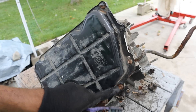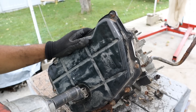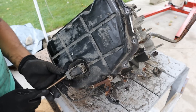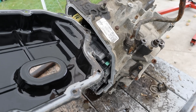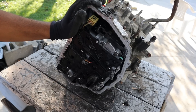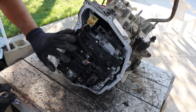This here is the trigger wheel for the output shaft speed sensor. Next I'm going to try to remove this transmission pan. Now some of these fasteners are so crusty — normally I'd use my wife's toothbrush but these are so crusty I might have to use my grandfather's toothbrush. And with a lot of prayers, we're going to try to get these bolts out. Well normally there'd be a wiring harness going here, but with copper being more expensive than meth and cocaine people have got other things on their mind. Now this is a 6F35 transmission — it was co-developed with GM back in the mid-2000s, so you'll find it on a lot of front-wheel drive GM and Ford vehicles. Now the Ford ones were less reliable and part of it was due to this valve body.